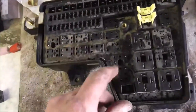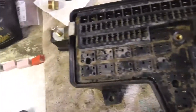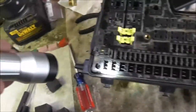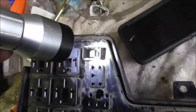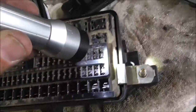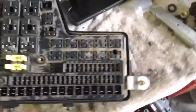Got all the fuses laid out. Next thing I need to do is break off these little plastic tabs that were melted on. They melt those on there to hold the top part on. I'm going to get to breaking those off — maybe just get a screwdriver in there and pop them. Once I broke all the little plastic pieces, there are little clips holding on to the outside of the case — you can see them right there. I'm trying to work those off all the way around. There's a little tab that the metal piece hangs on to, so I'm working on getting that out.